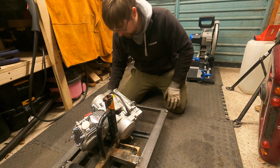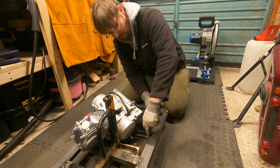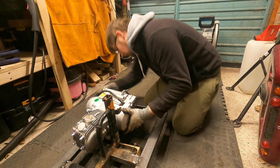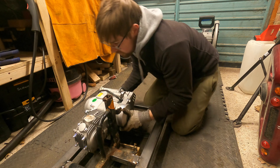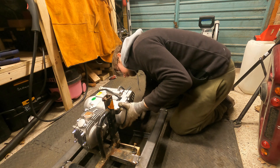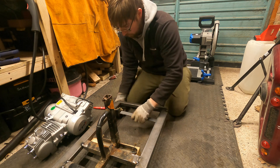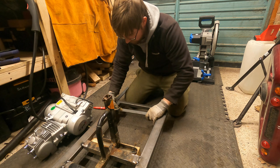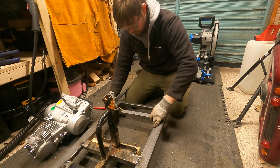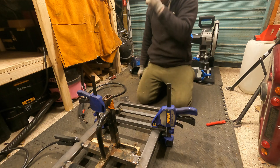This is going to be a little bit tricky. I've got a plate on the bottom of the engine that I need to get some braces going along for it to sit on. So I'm going to try and mark up roughly where the engine's going to sit just so it looks level - about there will be perfect. I've marked where the furthest point back of the plate is, so now I can weld the front one in and then sit the engine on and see how it looks. I need to blob a couple of welds on here and then we can see how the plate all sits.